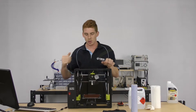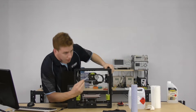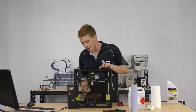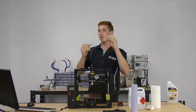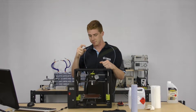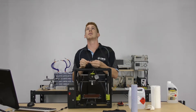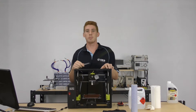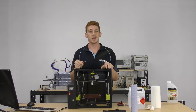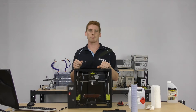Finally, we can take a look at the hot end itself. As we're heating up our printer, you'll notice that the printer goes through its sequence — it cleans off that nozzle, then sits at the front and waits to get up to temperature. While that's happening, sometimes you'll notice a little bit of filament coming out — maybe around an inch of filament will just sort of stream out of that hot end. What you can do is grab your tweezers and just pull that little whisker of filament away before the print starts. Otherwise, you might see a little tag on the skirt in the first line of your print, which isn't terrible, but you don't want anything there.